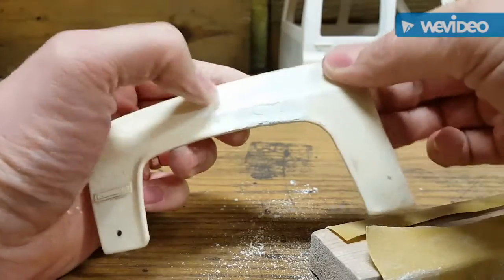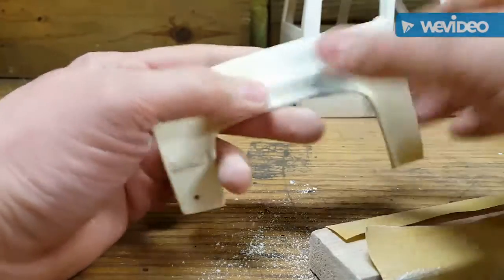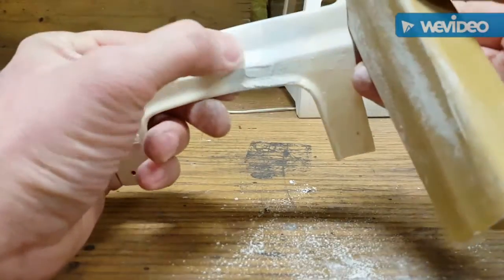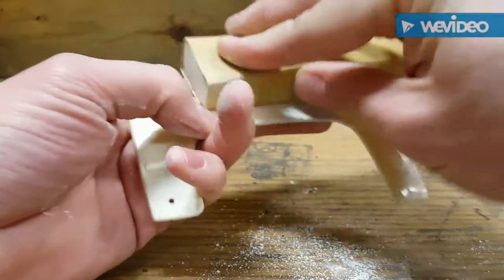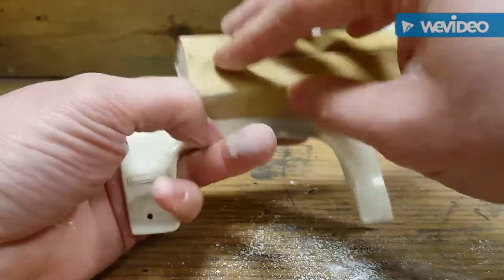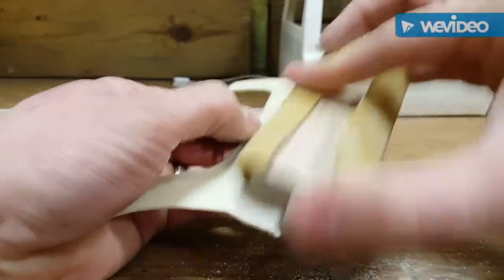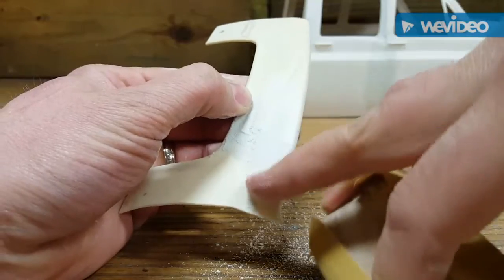When you're doing this, you don't necessarily want to sand away all the filler. I'm going to keep it feathered out, so when this is all painted, everything turns out to be a nice smooth surface. Because not always do you get this stuff put together perfectly flat. Which also, when you're sanding it, instead of me sanding over here, you keep your sanding block spread out over top of the surface, keeping the repaired part centered.